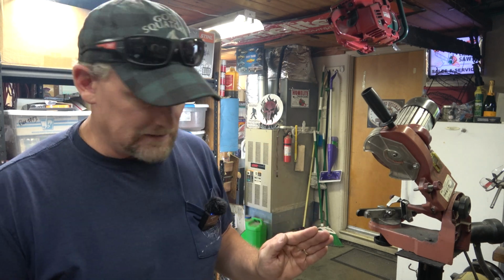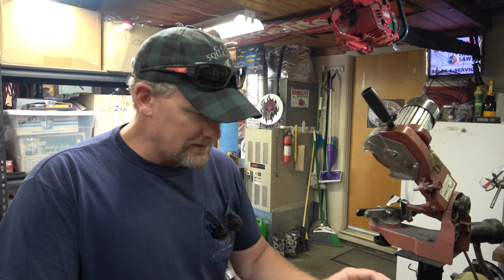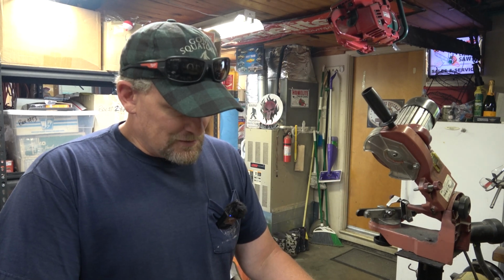I am completely comfortable with the way it started, the way it idled. There are no air leaks. I am certain of that. The way it loaded up, there are no air leaks. So, if anything, it's tuned a little rich for where I'm at right now with the atmospheric conditions that I have right now. I'm not touching it.